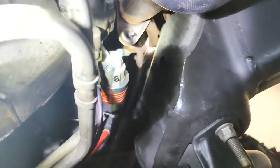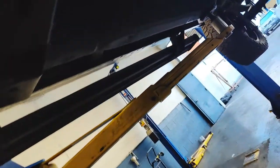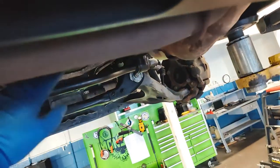And then we'll take off this clamp. We'll take off the two bolts, one bolt there, one bolt up there, where you're at, right there. Unplug the O2 sensor, take off this one, take off this one, and this one. We'll drop this, and we'll drop the exhaust. By that time, we should already have something supporting the tranny, because obviously our tranny mount is bolted to here.